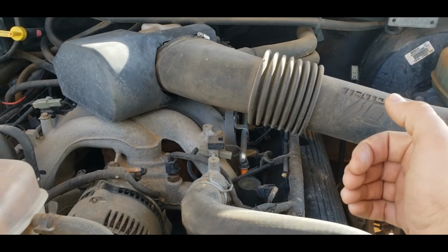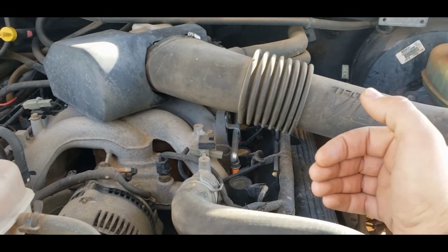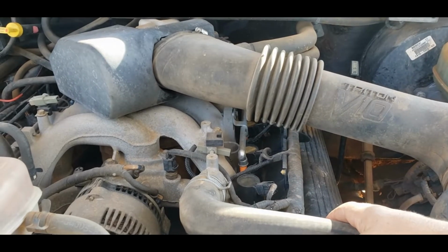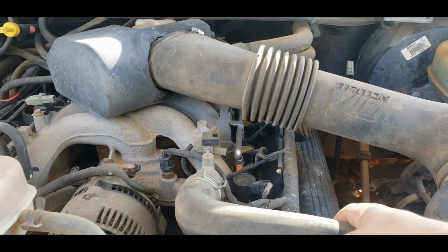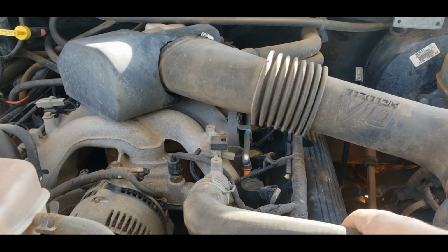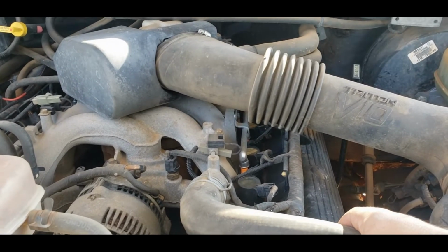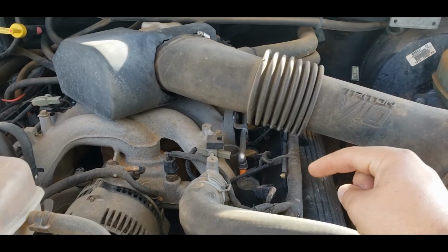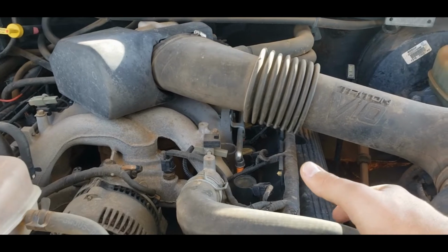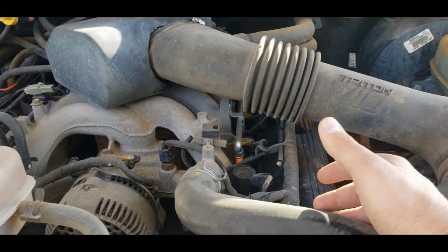if you take a chunk of the head out with the spark plug, there is a fix. It's a helicoil. It's been done on hundreds of thousands of these or however many they made before they switched to a little bit different design and allegedly fixed it. There's a whole kit you can put in, but it involves putting a helicoil in, which means the head has to come off. If you're really skilled, you could do it with the head still on.